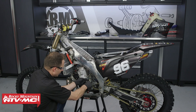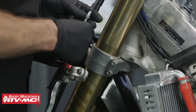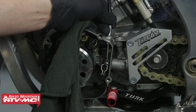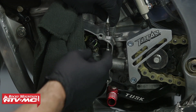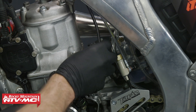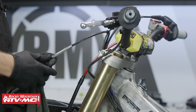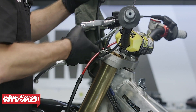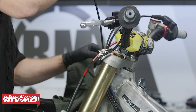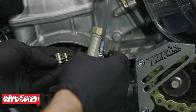So we're now ready to mount up the slave cylinder. To do this, we'll disconnect our original cable. To get this cable end out, you might need to loosen the adjustments on your cable. Now that we have enough slack in the cable, we'll go ahead and remove it. Don't forget, we have this retainer, so you do want to run your new hydraulic line through that. I'm going to pull this cable all the way out and completely remove it with the stock perch. So now we're ready to mount up our slave cylinder, and this just goes in right where that stock cable went in.